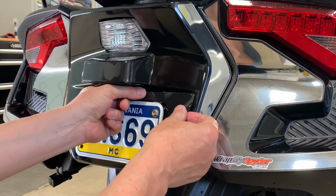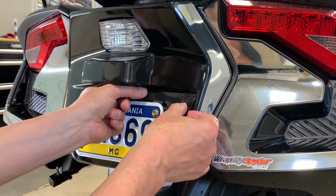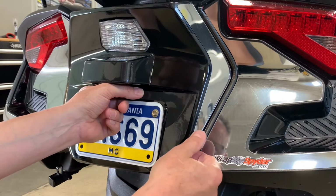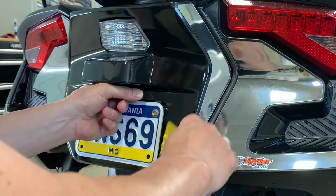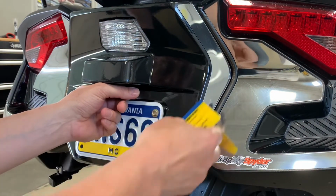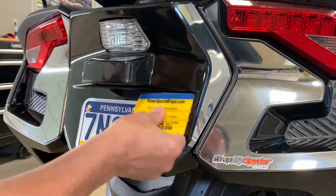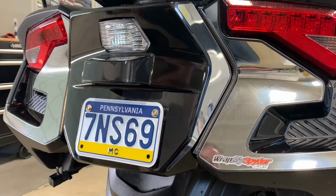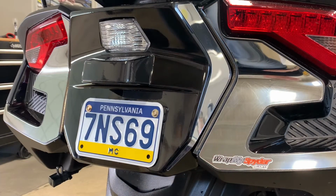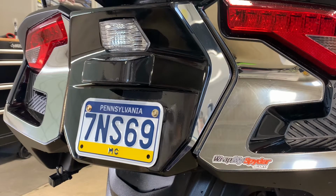So basically you can hover it in place, make sure that it's horizontal, and it will fall into place, and then you can just take your squeegee down, and it should fall pretty much straight across the top as well. It's not too crazy to do your dry application with the reflective film, but reflective film typically is a lot tackier, especially way more tackier than our wrapping film. So you just got to take your time.